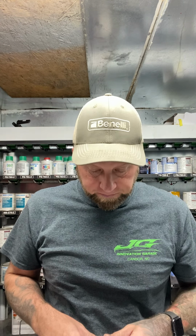Well, Mike and Brandon, once they blow it out, they blow everything out outside in the yard or in the driveway. It is 95% super clean by the time I get it. And then I blow it off one more time. I make sure it's blown off before I bring it in the booth. And then I tape it up if I need to be taped up. And then I go ahead and spray epoxy. I put several coats on it.